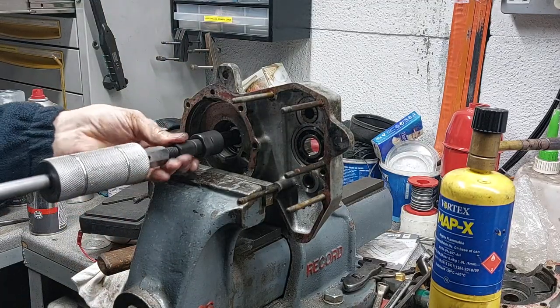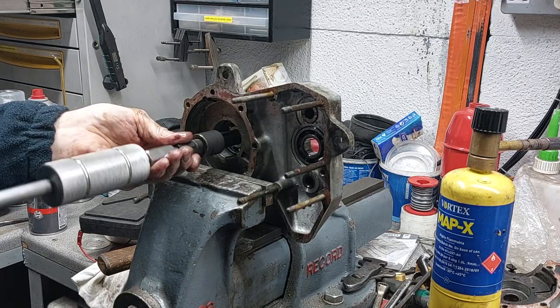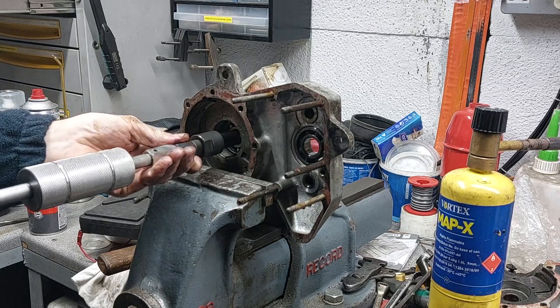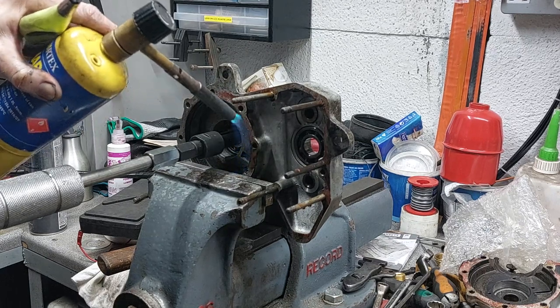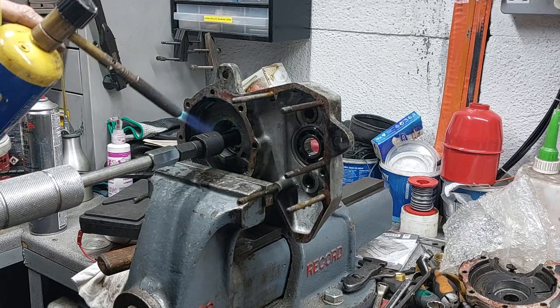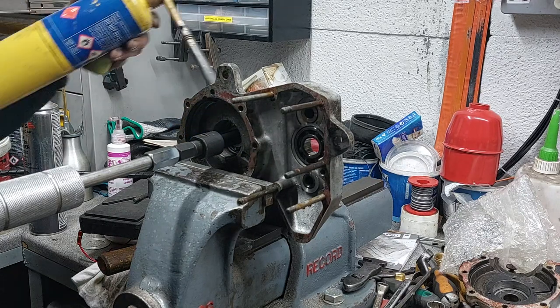One of the main bearings was still in the housing, so I installed an internal bearing puller. It's sort of like a slide hammer that expands just inside the bearing, and it does come in handy sometimes. So just another case of heating the cases and making sure it's well supported in the vise, and then give it a few whacks on the slide.